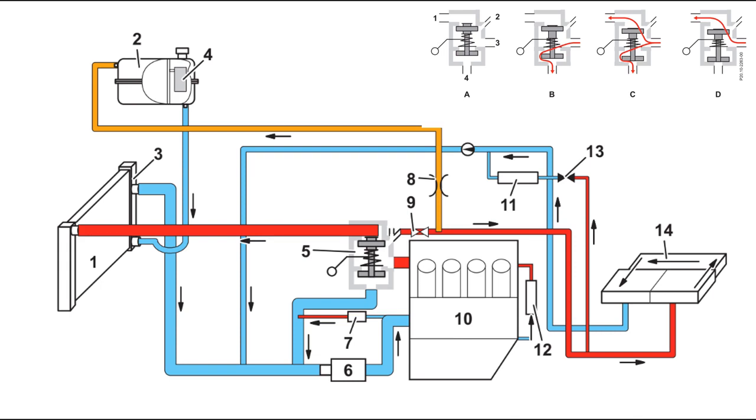The oil circuit is supplied by a regulated oil pump, offering high displacement in a small installation space and high efficiency. The regulated oil pump is designed as a vane-type pump; with its infinitely variable delivery rate, it is able to regulate the oil pressure. It is flange mounted on the end face of the rear bearing seat of the Lanchester balancer housing and is driven by the intake side balance shaft via a pair of gear wheels. The oil pump is regulated on the clean oil side. Oil is taken from the main oil duct and directed into the regulating chamber, where it pushes against the spring-loaded set collar of the vane-type pump. When the target pressure is reached in the main oil duct, the set collar is pushed against the spring force so that the eccentricity of the vane cell is reduced, decreasing the effective size of the oil pump so the delivery rate decreases and the oil pressure cannot rise further.